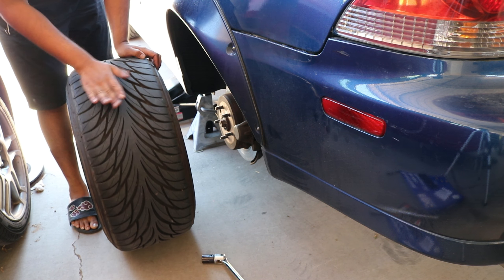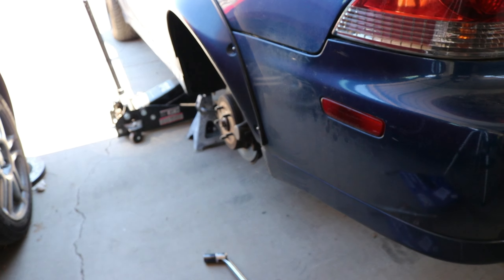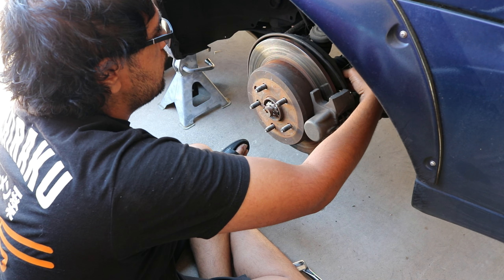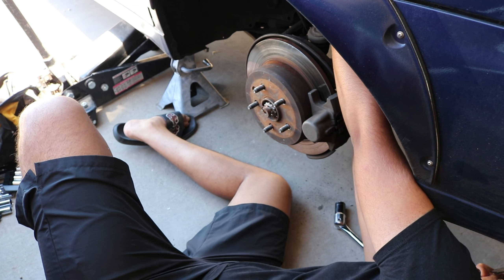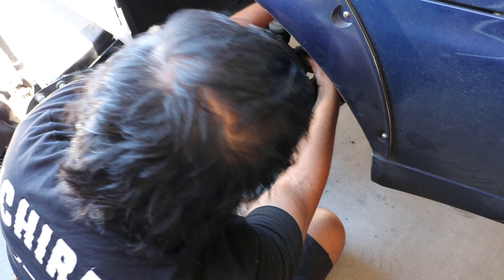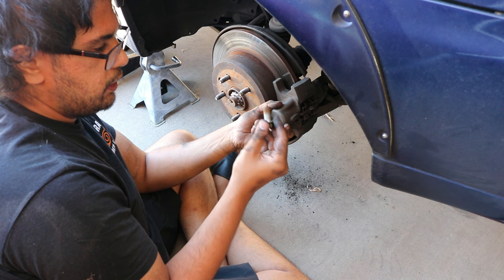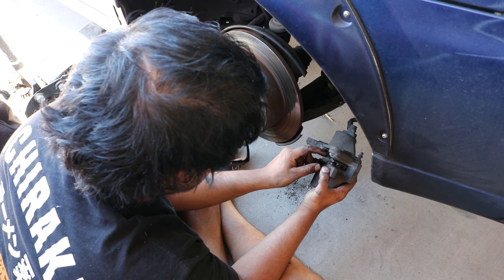Oh wow, that's a lot worse than the next one. Here's my tire — I'm gonna go keep this nice and safe so it doesn't get too messed up. There should be two 17mm bolts holding the caliper on, right around here. The two 17mm bolts are going to be behind the caliper, one up top. That was definitely rust holding it together. Okay, so here's the caliper coming out — holy shit, that's really bad.